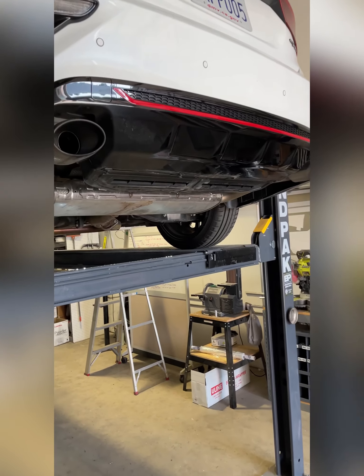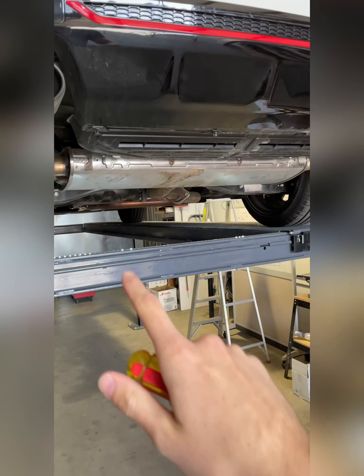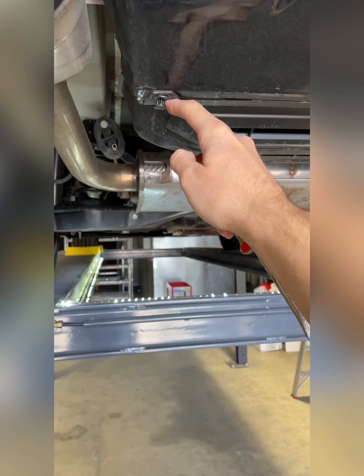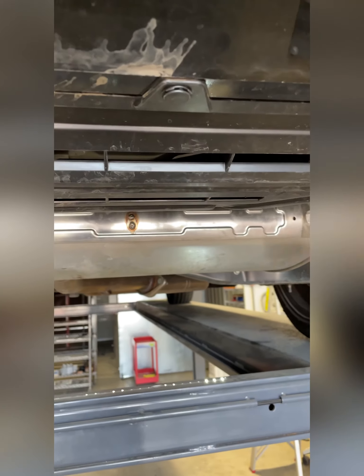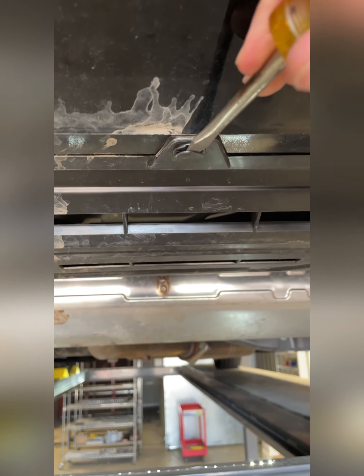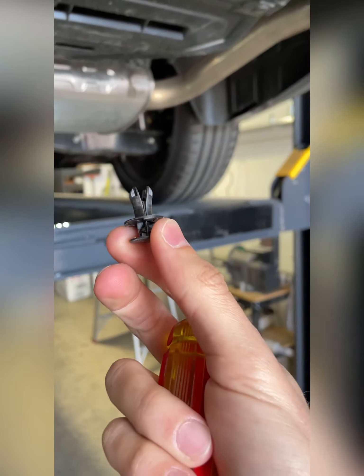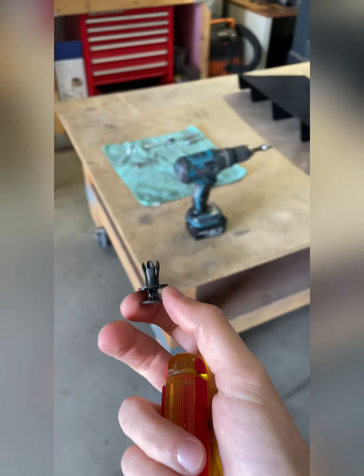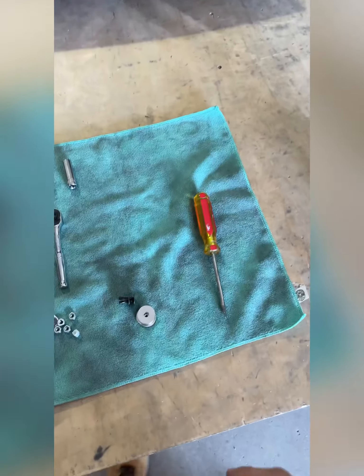So here is our Kia Forte GT. You can see the GT's got that dual exhaust with a large rear muffler. We're going to start by removing these four clips. I like to use a flathead screwdriver — you can see I already popped this one out, but as an example here's the third one. I'll stick this in there, turn it just a little bit, and it opens up and you can pull it outward. These clips are really easy to remove and install, but we will not be using them after this — they just will not hold a diffuser.